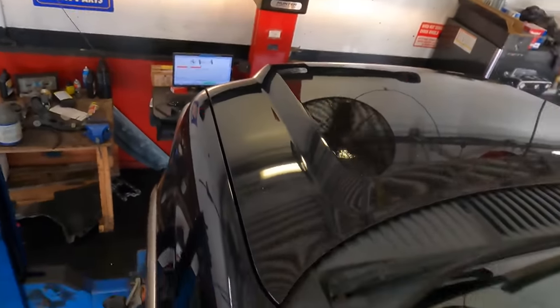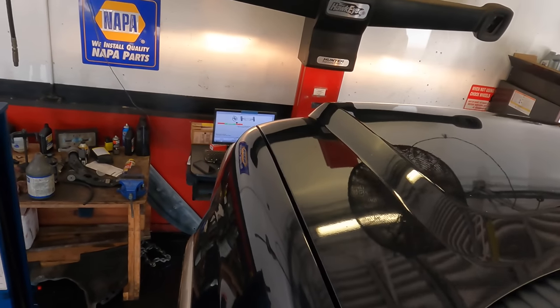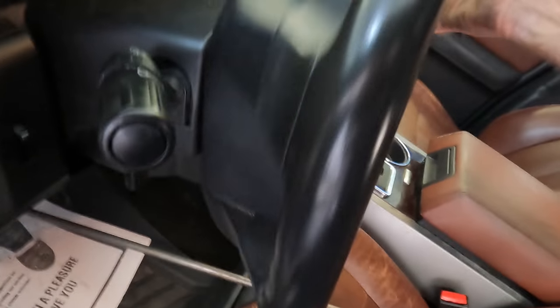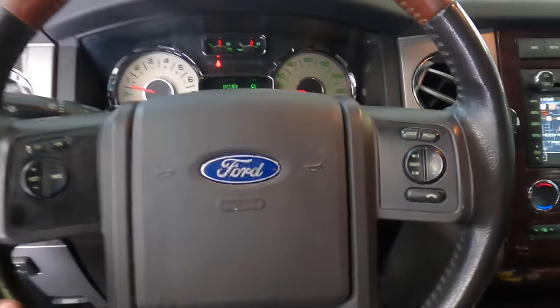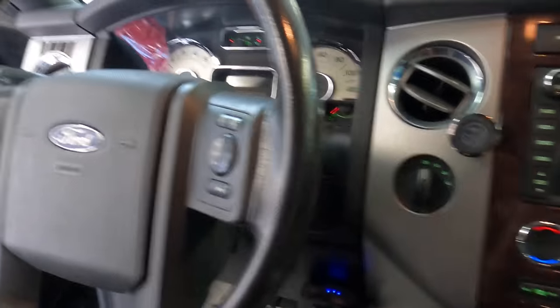We're going to do left and right sweeps of the steering wheel. Turning left follows the arrow, it takes a measurement. We go to the right, follows the arrow and takes a measurement. Then we go back to center. Measurement. Measurement complete. Let's center our steering wheel visually, and there it will stay. Powering down.